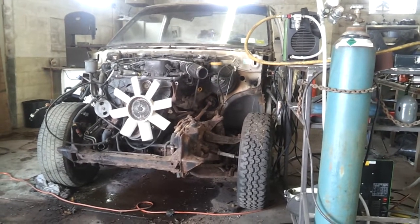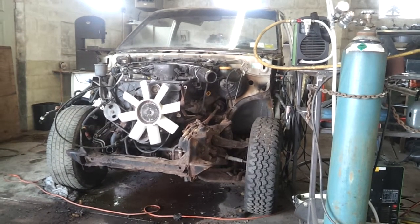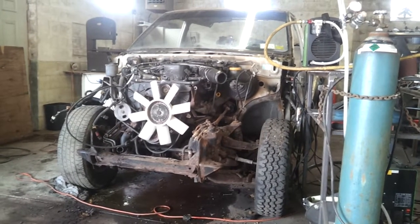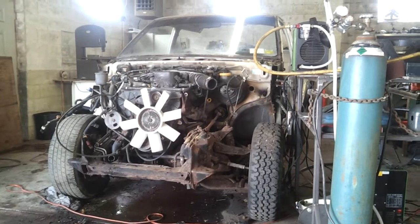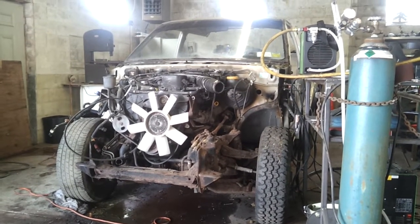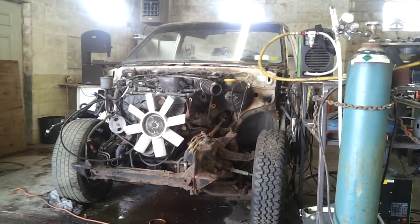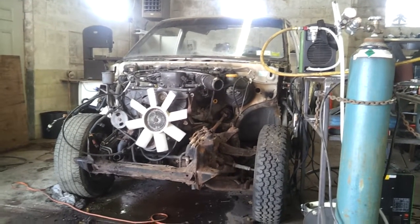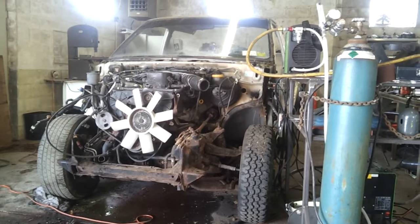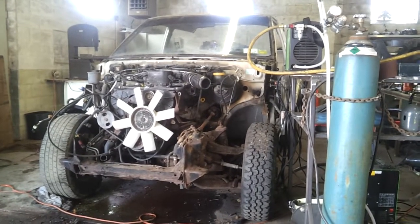Part of my issue was the cost of the joints for the links. You can get them from about 30-something dollars up to 60 or 70 bucks depending on where you buy them and what type and size you need. For a front four-link, I'm going to need eight joints — and that's not including steering. I was looking at Johnny Joints because they're a bit cheaper than ballistic joints, but they're still around 50-something bucks each, not including shipping. It just started to get expensive, so I figured I'd check out the radius arm setup.